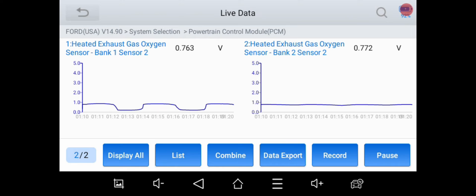Imagine if the catalytic converter wasn't there and you just had a straight pipe all the way back — the downstream O2 sensor would look exactly like the upstream O2 sensor, because the same amount of oxygen hitting the upstream sensor would also be hitting the downstream sensor. The catalytic converter burns up those emissions and uses up the oxygen, so you should see a nice, stable, pretty much flat line.